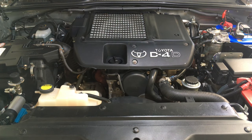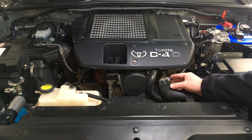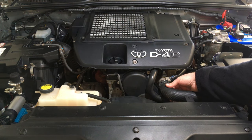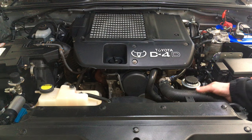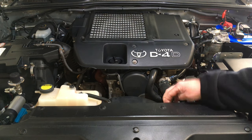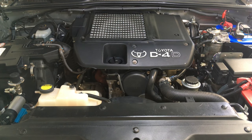These are really good hoses. Non-specific to Prados, let's talk about checking hoses: check what it looks like. Obviously if you see any corrosion, any sort of wear and tear from looking at it, you can give it a squeeze. If you feel it crack, or they've gone hard — if you squeeze and it's like rock hard, like plastic — then the hoses are just rubbish.